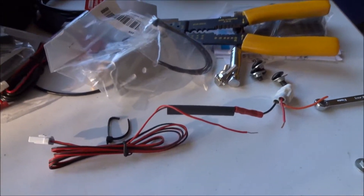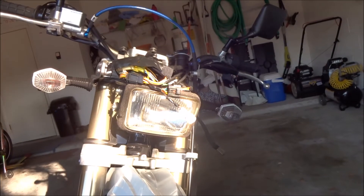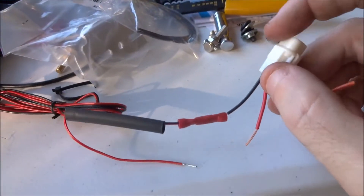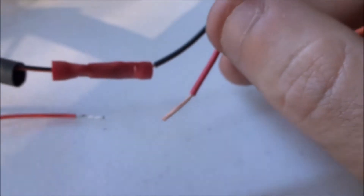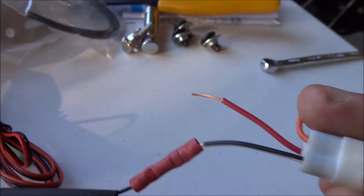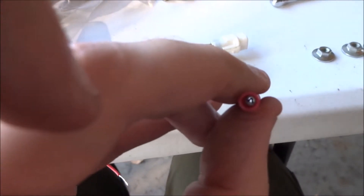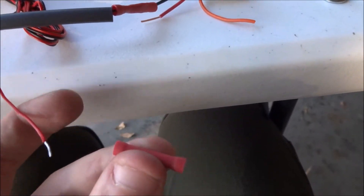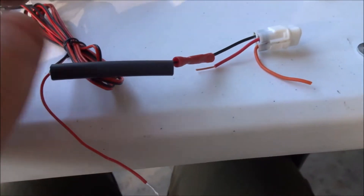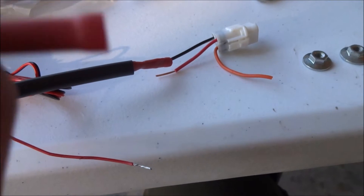I can confirm — I just did a quick test plugging in this half of the socket into where it used to go and I manually connected the two red wires and the dash turned on when it was plugged in on the other side. I've crimped the black one already, and basically I'm just going to use another one of these to connect the two reds with a piece of heat shrink so I can make it all nice and tidy when I'm done. Then this little wire splice job should be all done.